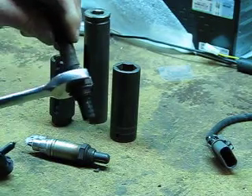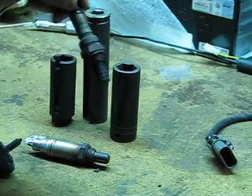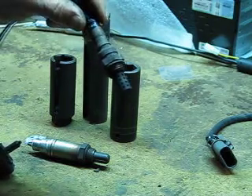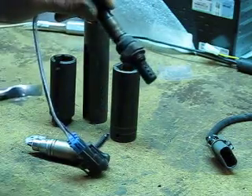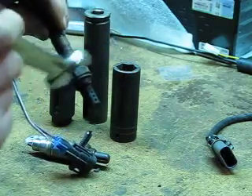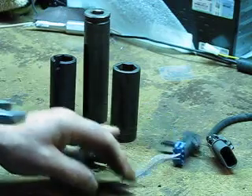To put the new sensor in, you can just use the open end. They don't have to be that tight — just tighten them up. Ideally, screw them in finger tight until the gasket touches off and you can't turn it with your fingers anymore, then go about a quarter or half turn more. That's it, you're done. You don't have to reef on it.